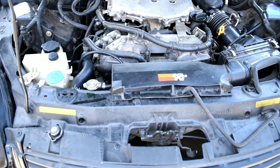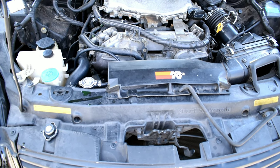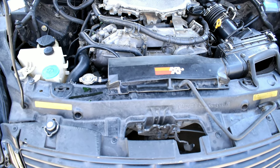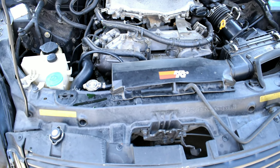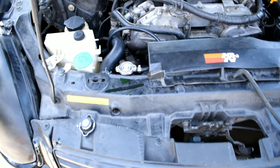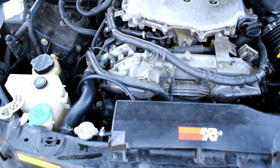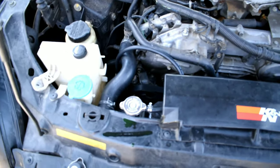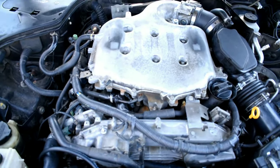In this video I'm going to show you exactly why my car was overheating, which is a really common reason why G35s overheat. If your car is overheating and your heat doesn't work, it could just be that you have air in your cooling system, which is really common in the G35.